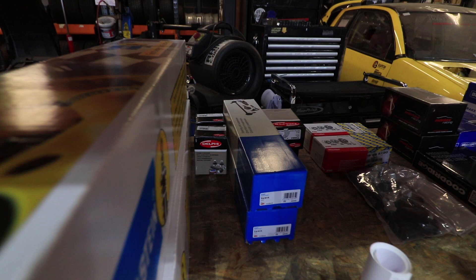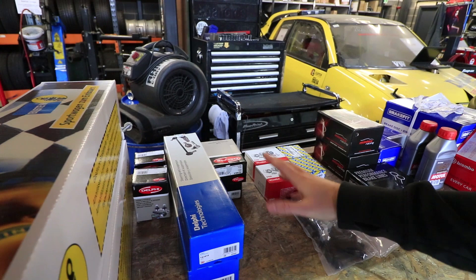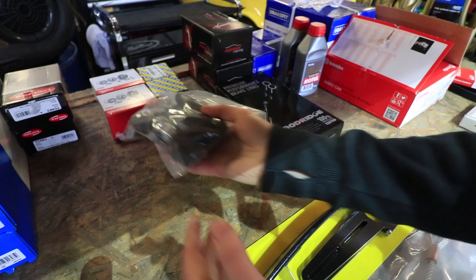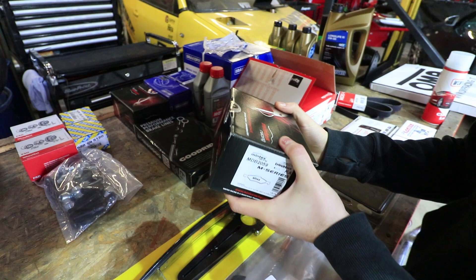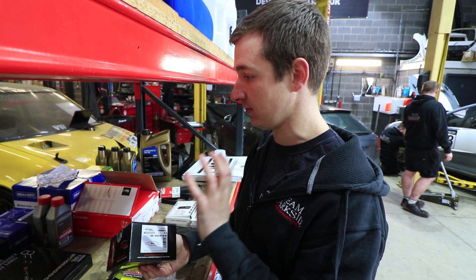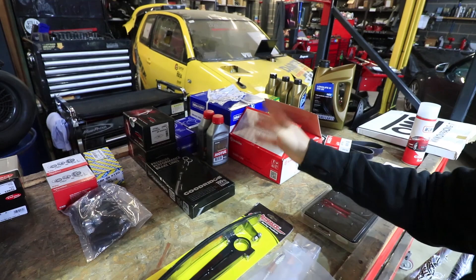These are not mandatory parts but it's an old car and we want it to be right, so we've got track rod ends, track rods, ball joints — all decent brands — wheel bearings, and upgraded longer wheel studs from Grays. The brake pads are Mintex — I think these are the 1144s, so not a cheap pad. A lot of races like this just run standard road pads that drop to bits; these should last around six hours on a set. Goodridge brake hoses — one of the few things on the braking system you can upgrade. Always a good idea in case previous owners left calipers dangling with nicks in the lines.